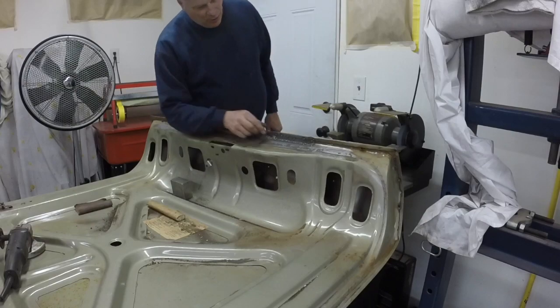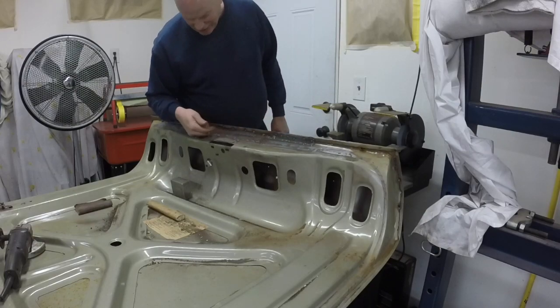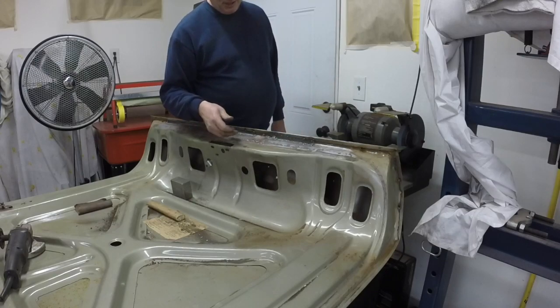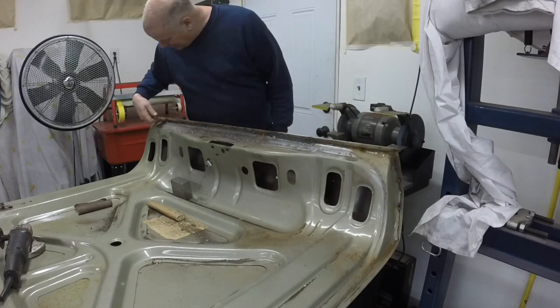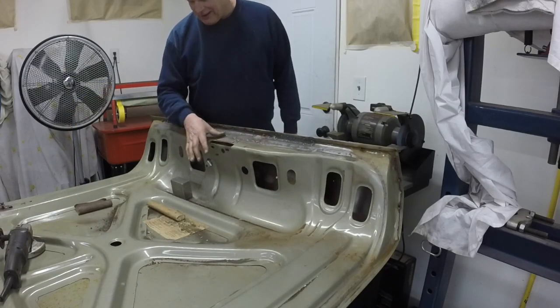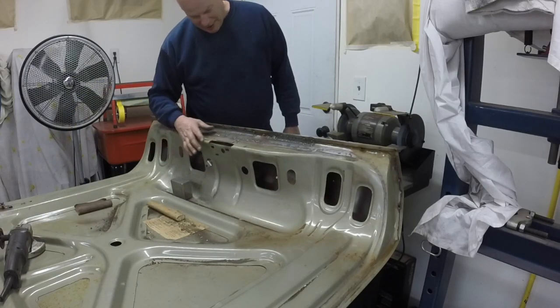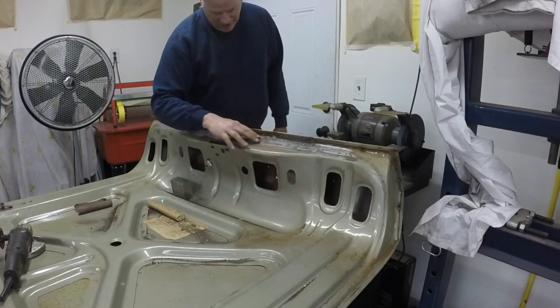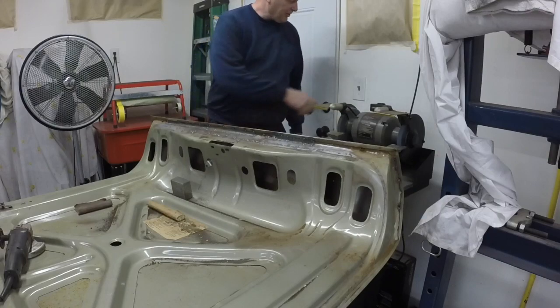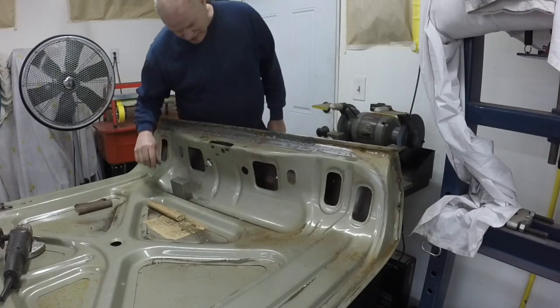Flattening this back out over the sheet metal, I just spot welded every so far like it was originally done with it jammed up in there. Now I'll just put the seam sealer on that joint all the way around. This I'll grind out and probably have to put a smidge of body filler on these welds to fill the pits. Here, I'll turn the exhaust ventilator off.